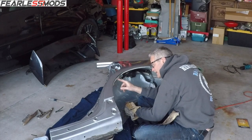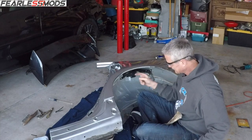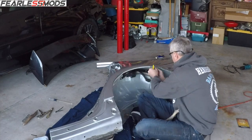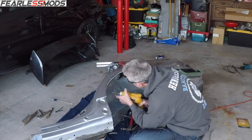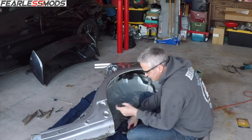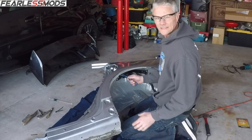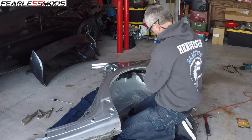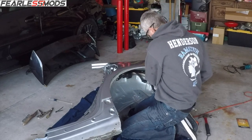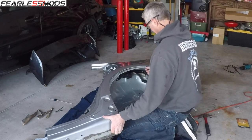Oh my gosh. More welds. So the razor blade trick helped me find out that there are more welds. It feels like something's hanging on, but I think what it really is just a lot of the seam sealer, and I don't want to bend the outer skin at all. Get in here, look, there we go. That popped real nice with my little plastic tool.